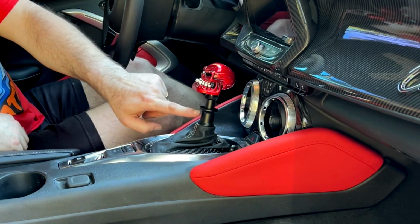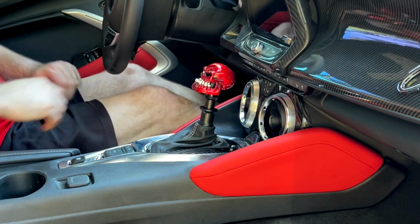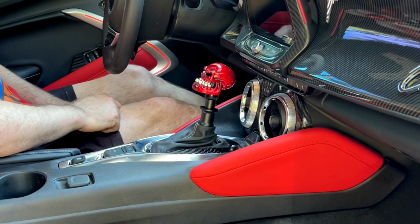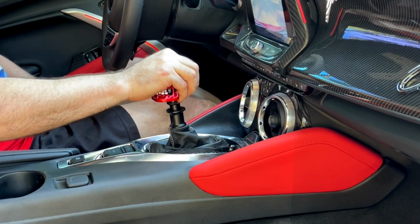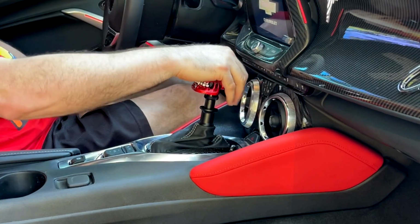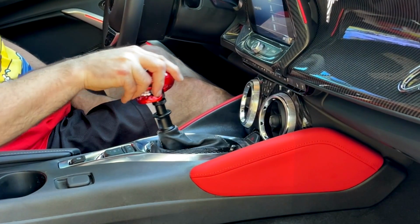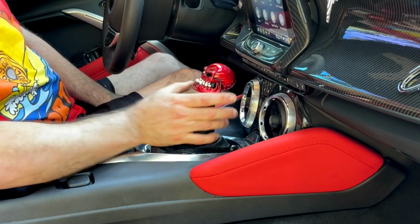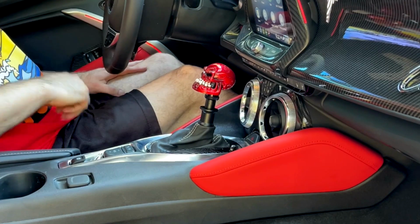And once you get it on there, once you have it screwed down tight to the liner there, you'll be able to shift now simply by pushing down and using your shifter. So all you got to do is push down going from park to reverse. You don't have to push down for anything else. It's just when you're going up into reverse or into park. I think you get the picture now. Once that's on there, tightened down, that'll be my new shifter.